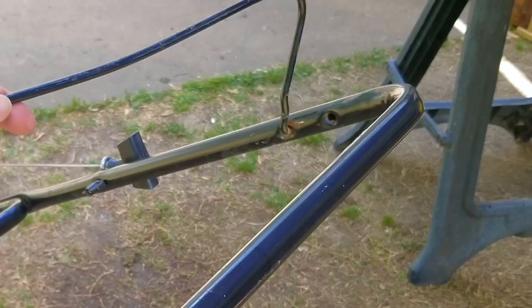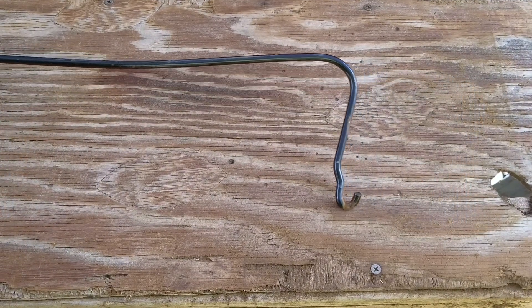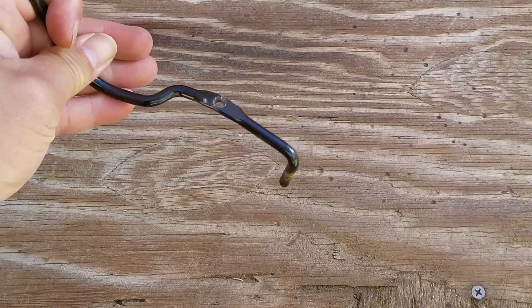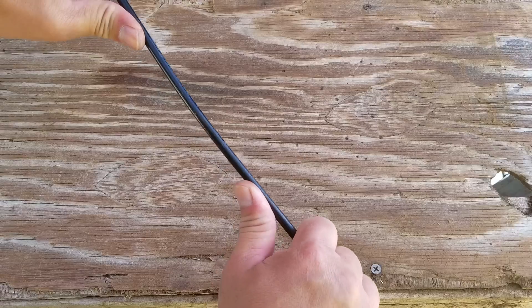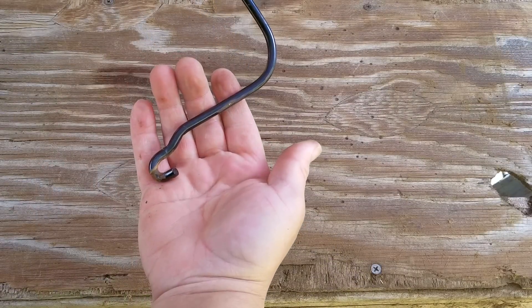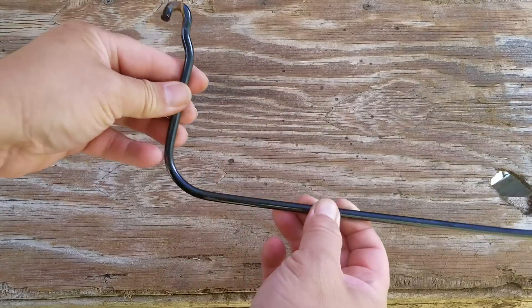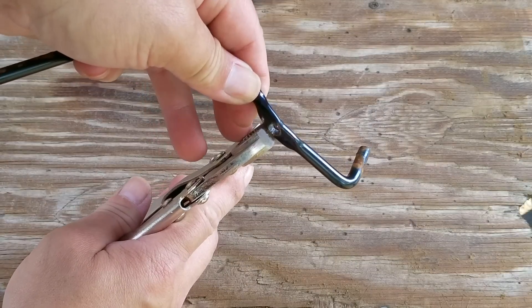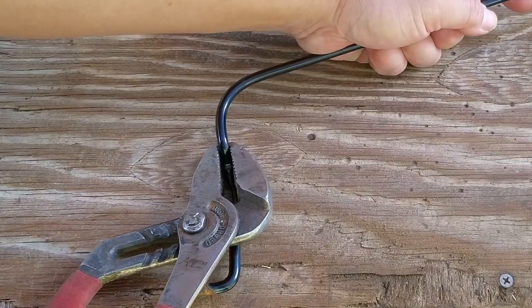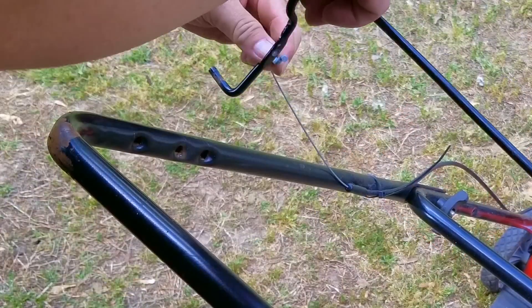Speaking of hack repairs, we finally come to the part I'm not comfortable with. This handle is really easy to bend, but the metal is also really easy to break. The most likely area to break is the left side of the handle where the opening is for the Z-bend for the cable — there's not a lot of metal there, so if we bend it too much, it will break. At least if we do break it, it won't be expensive to replace. The other end of the handle where there's plenty of metal is not a real concern, so I'll tackle that side first. Just go slow and try not to get too aggressive, otherwise you'll end up with a two-piece handle. I think I'm not going to go any further bending it back — this should be good enough. After looking at my handiwork, I'll reinstall the handle, reconnect the brake cable, and try it out. As long as it works and I'm confident it's not going to break, I'm happy with the repair.